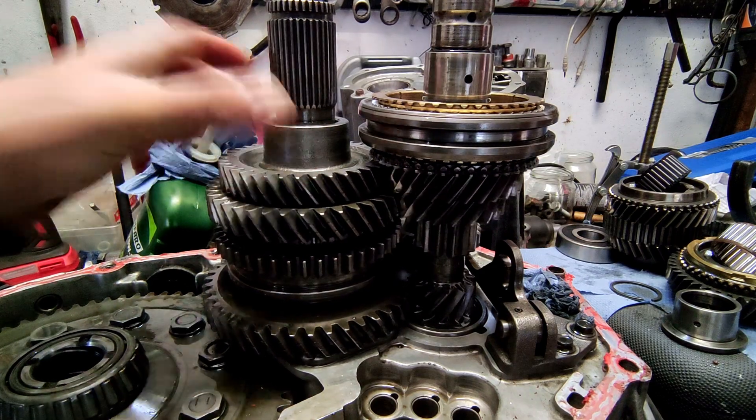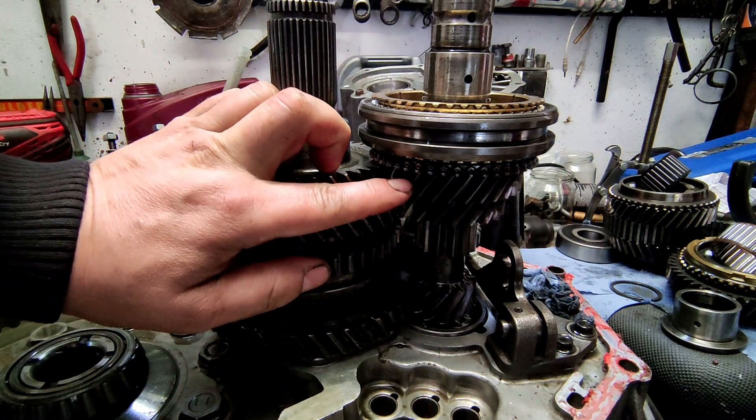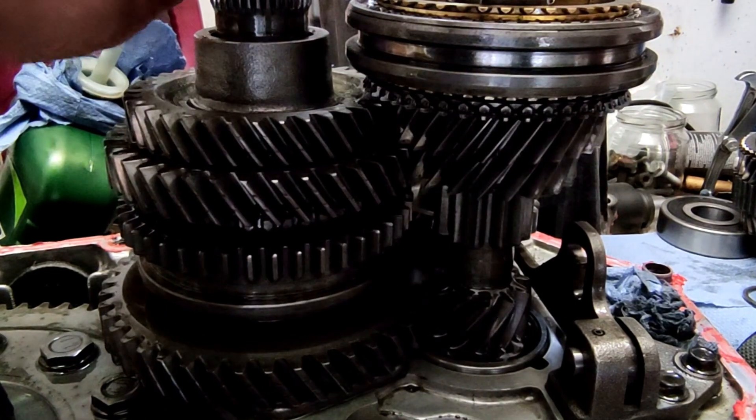The input always consists of two gears: a fixed gear wheel and a loose wheel which is supported by a needle bearing. The idler gears sit on the input shaft, and the fixed gears sit on the output shaft, which leads to the differential.